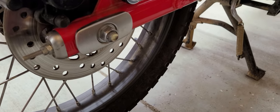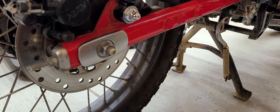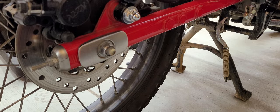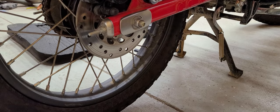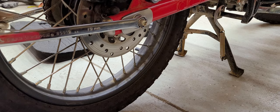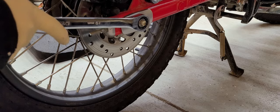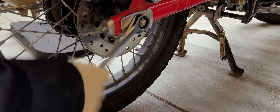Let's get started. We've got to loosen this nut right here first of all. Then we're going to loosen off on this and let the axle and wheel move forward. I've got it on the center stand, so that helps a ton. We'll have to hold the other side with the 14 and loosen that with the 19. I like to use a little bit of a long wrench so you don't have to tug on it so much. We'll hold this left side here and break this one loose. This side's got a ratchet wrench, so that helps a lot.